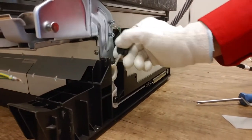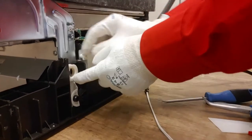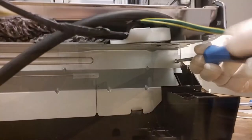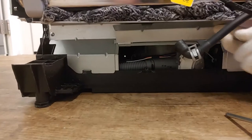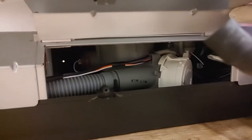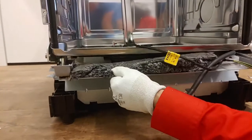Loosen the two ground wires and put the screws back. Take off the black plastic piece and the white clip behind it. Take off the lower cover by removing three screws. In case you only need to get to the drain pump, take off the front plate, the door, and the lower bezel, and remove the middle screw that holds this flap. Take off the plate.